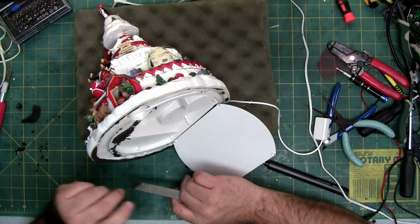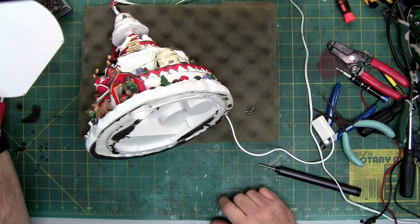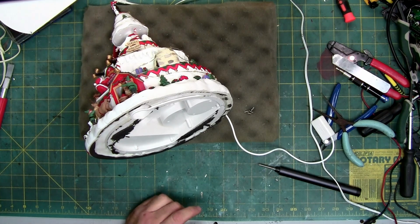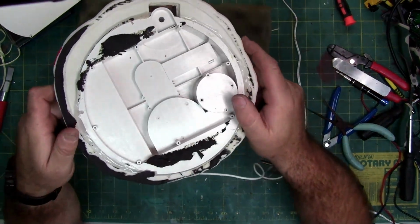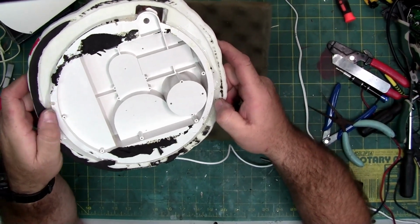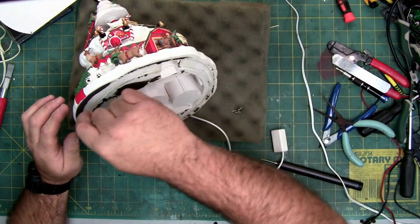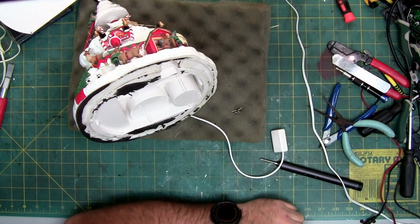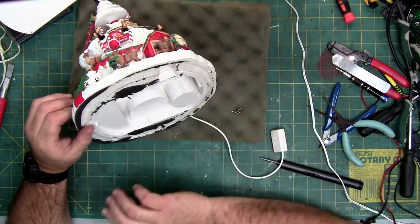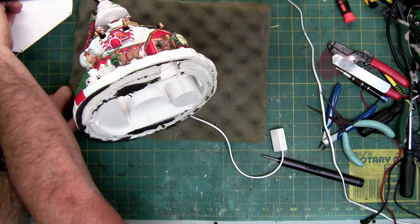This is absolutely useless. Literally, if you just tear the edges of the mat off, I'm going to show you here in a second, you don't have to worry about the screws. It's absolutely useless to try and tear the center off to get to the screws. Here's why. It doesn't do anything. So if you can tear the edges of the mat off, this is where mine was stuck in the glue a lot, and then right here too, you need to break this glue seam, not get to the screws. So you can literally just peel the mat and kind of wrinkle it in so you can get around to where the hot glue is. So the screws are covering a bottom that has no point. There's no screws, there's nothing in here that's removable or serviceable. So yeah, it was a waste of time.